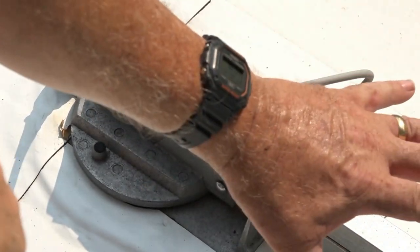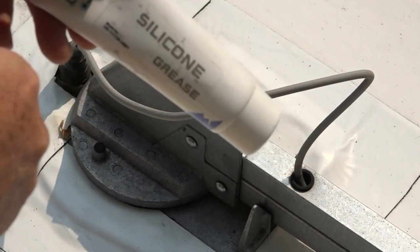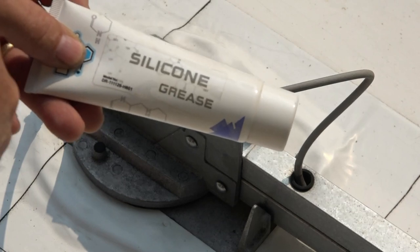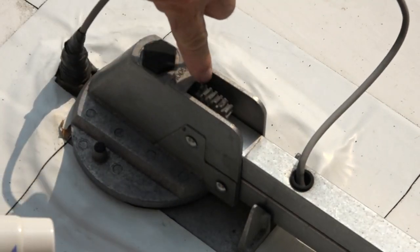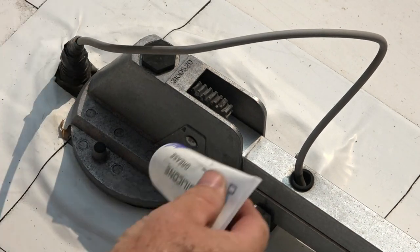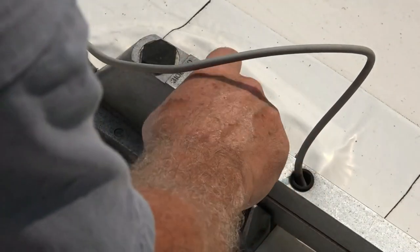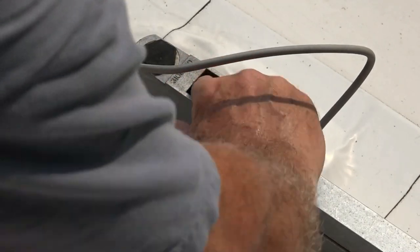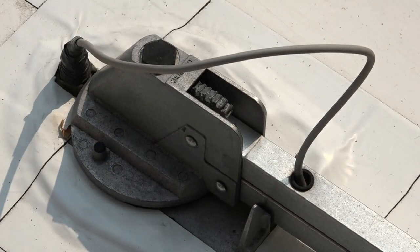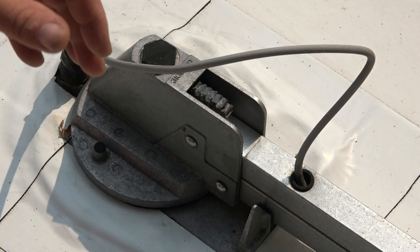One of the things I like to do while the antenna is down is put some silicone grease on this gear right here — it makes it go up unbelievably easier. Just get some on your finger and smear it in the gear. I find without the grease, every year or two it gets very hard to crank up. Let's go check the antenna and the stations.